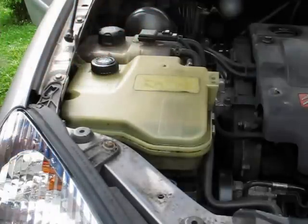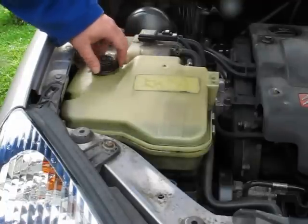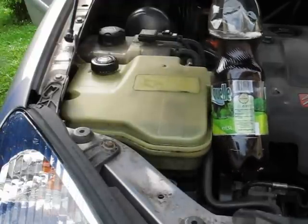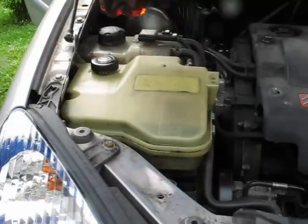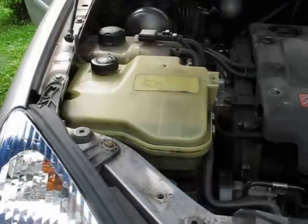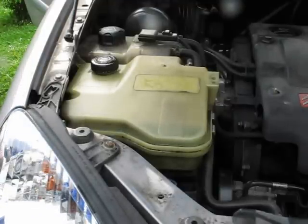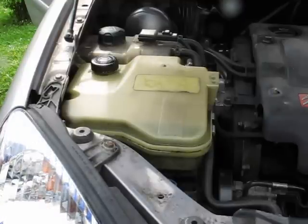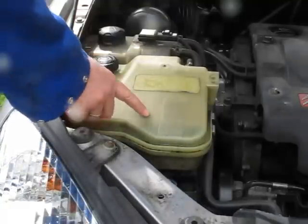At least it was the case with my container. So what I did before depressurizing: I unscrewed the lid here a little bit and removed quite an amount of hydraulic fluid — approximately a good litre or so — to make room for the fluid flowing back from the depressurization process. I've got the Lexia connected inside the car and I am going to select the depressurization sequence now, and you can watch the fluid level rise here.